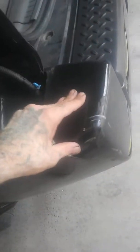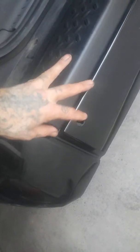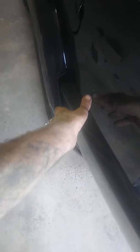That's easy. Just take a heat gun and reshape there, you can see kind of how it's smacked down in from impact. And then the one reverse sensor is just hanging underneath there. He pops that back. But there's all kind of room under there. I don't even need to take his bumper off to do this little job. And we paint it, just go into the corner here and down that edge. Be a piece of cake. And then I'll pull those clips out here for the tail light where they snap in and PDR that wave. There you go, now you can see it right there. That way I don't got to get into the quarter panel, touch stuff like that up. And that was about it for this thing.